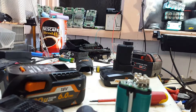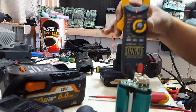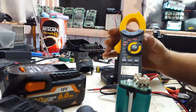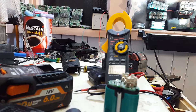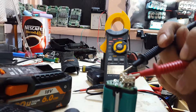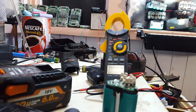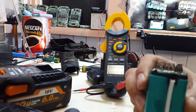Let's see if it's got any voltage in it. Yep, alright, we're on DC. 10.43 — so it's on the side of flat. They run up to 12.6 charged.